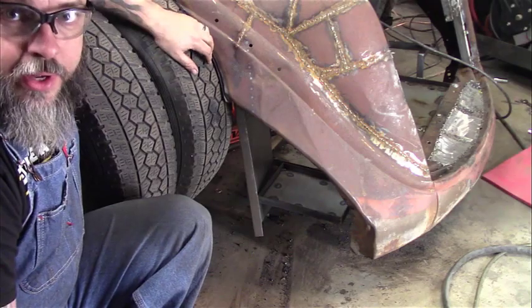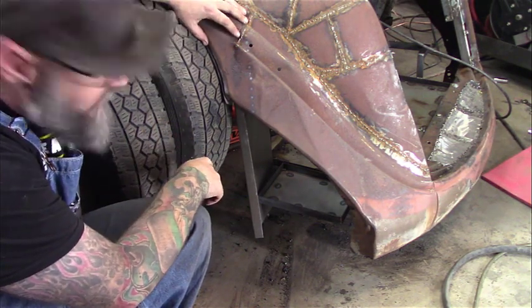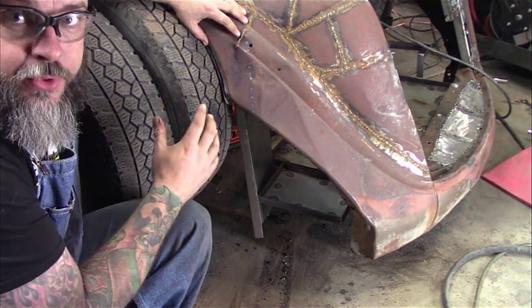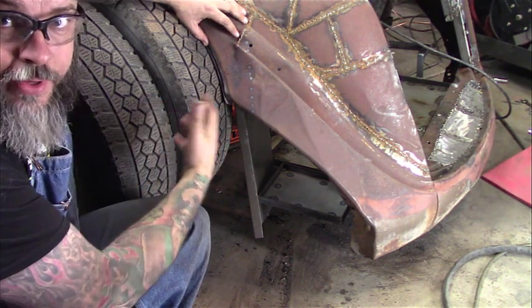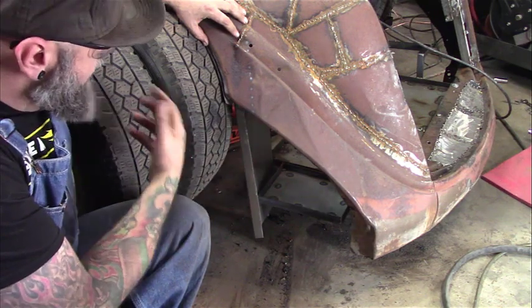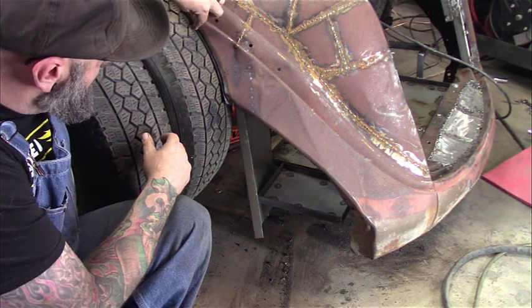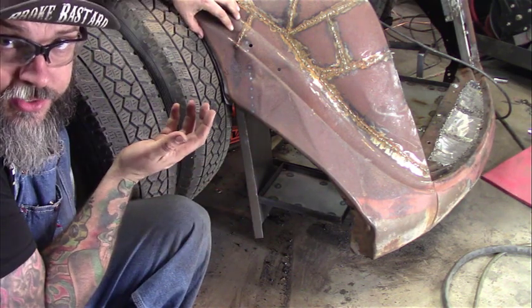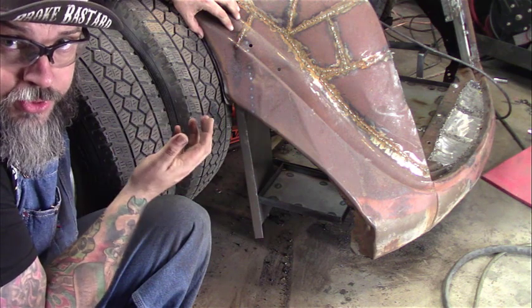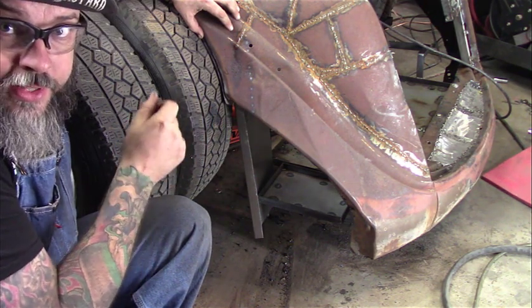What I've done is cut a piece of sheet metal to match this angle here and bent the edge. The reason I'm doing this is I need to make the inner fender wells for the back so I can then shape out the trunk - I have to do this first. This is just 16 gauge. I'm going to tack it in a few places. I've jacked up the tire to compress it into the fender as much as possible to hold the sheet metal to shape, and then I'll pry it the rest of the way so I don't burn the tire.